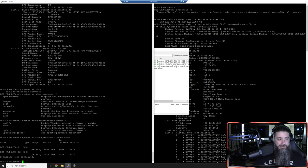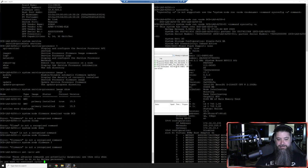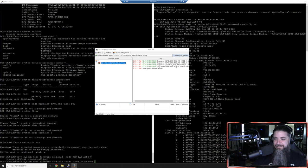We're going to download the zip file from my HTTP server, then boot back to the loader prompt and run the command 'update_flash' - it'll automatically detect all of that. You have to do 'set privilege advanced' first - that's a lesson you have to learn. So 'set privilege advanced', then 'system node firmware download -node dcd01 -package' and then paste in your URL. Download started - you can see it's getting pulled from my HTTP server. Then 'update_flash' at the firmware prompt.